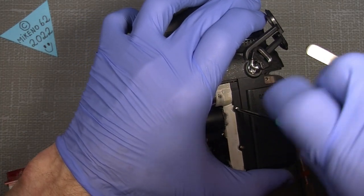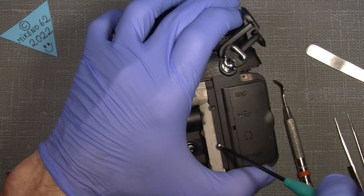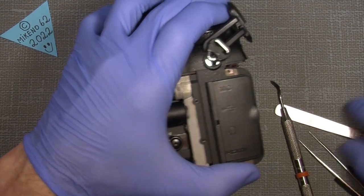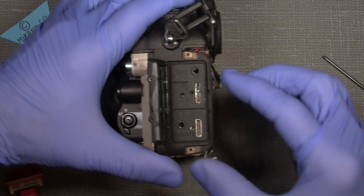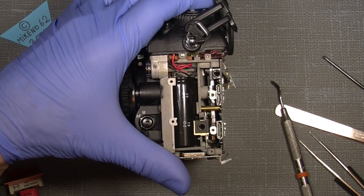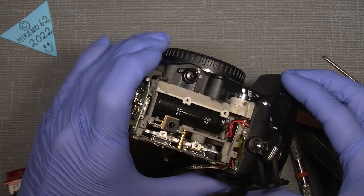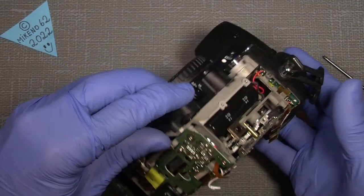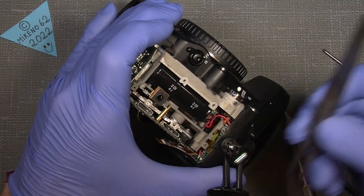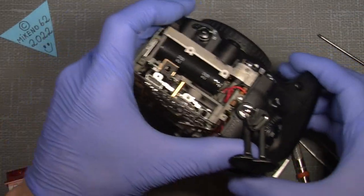There are two screws here that hold the cover, and just take it off here. Then you can pull it off. It's better if you just lift up here on the lid, and then it's free. Now, to something that can be pretty dangerous for some people, and this is the capacitor here. You see, it's quite big. To discharge it, you do not just take a tweezer or screwdriver or whatever and simply make a short circuit. No, you can damage something.